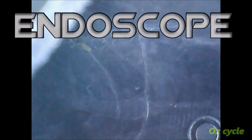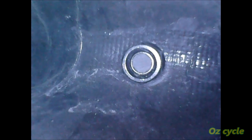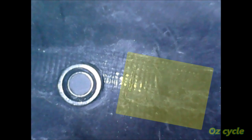Now let's have a look at the carbon work inside of these Elitewheels Drive rims, because we can. First off, we see the spoke nipple, and it looks round because we're looking directly down on top of it. It's difficult to see, but it's actually hexagonal shaped. We'll see that in a minute. Quickly moving on to the side there of the nipple, and you can see an extra layer of carbon fiber. This runs all the way around the rim bed. It gives an extra layer of reinforcement for the high tension loading from the spokes.